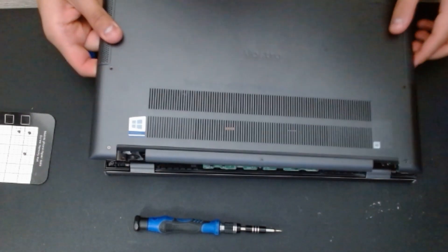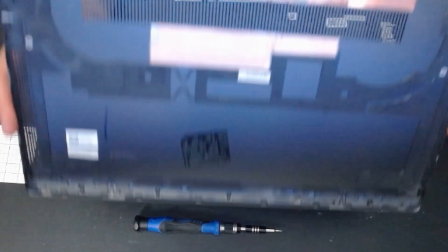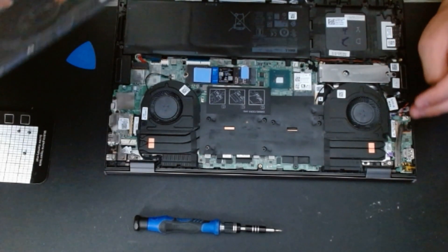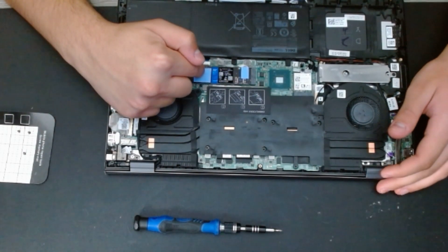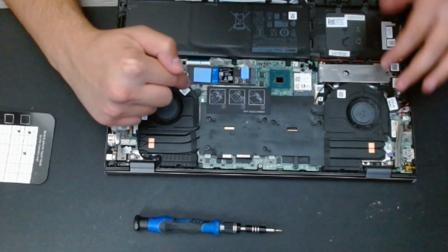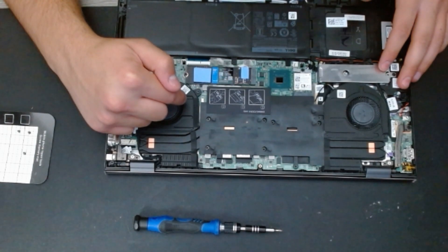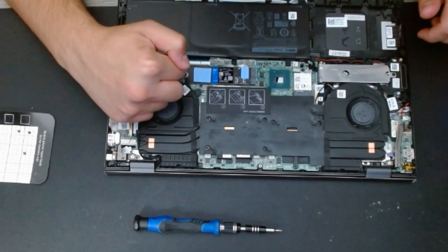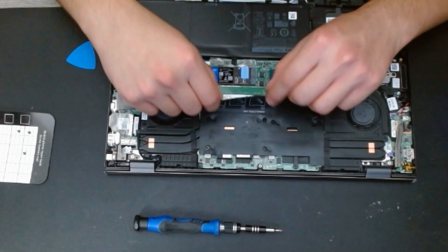Open the case like that. This person used the laptop very clean — there is no dust and the fans are okay. I already upgraded this laptop with one terabyte NVMe storage; there was also a 256 gigabytes SSD already installed. I added the one terabyte drive, and the RAM DIMM slot is right here.